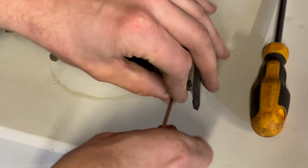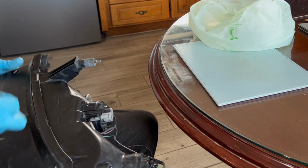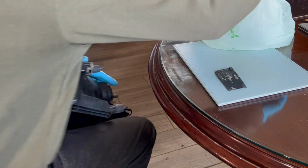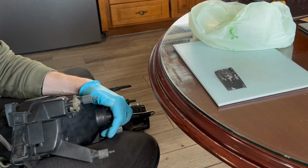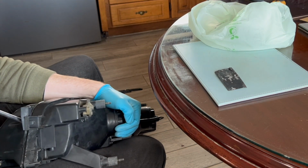It's wanting to slip. I started off trying the heat gun method and found it absolutely useless. It didn't separate it at all. So I put it in the oven at 100 degrees. That wasn't enough. So I put it up to like 150. I think you just got to commit, get the glue hot enough. Then once you separate it, get a start on it. It's going to be pretty hard at the start.